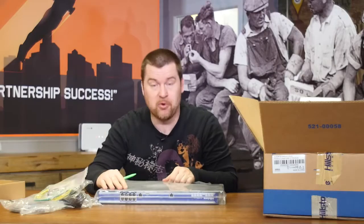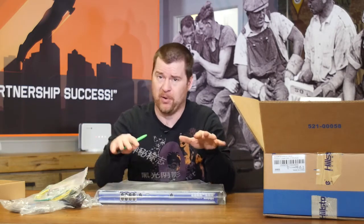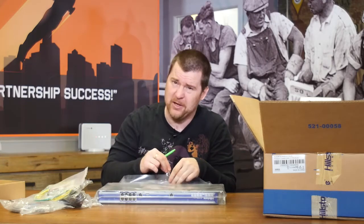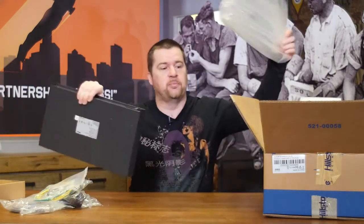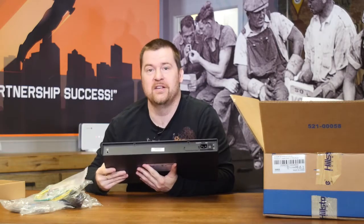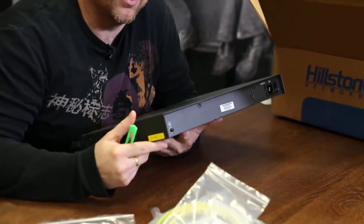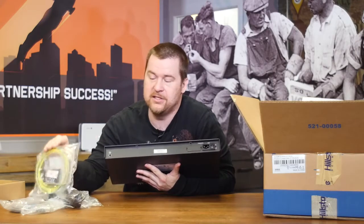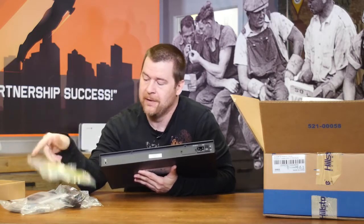One more piece of advice: if you just brought the box in from around minus 10 to minus 5 degrees Celsius, let it reach ambient temperature before you plug it into electricity. Otherwise you can have some pretty strange consequences, because condensation and electricity don't go well together. On the back side of the appliance there's an IT non-professional-proof interface — meaning electricity only. You plug in the power and that's it. And as I mentioned, you have the grounding connection here. The yellow-green cable means grounding in electrical systems, so it's safe to touch. Connect it to the grounding point here and then the other end to your ground point in the rack case.